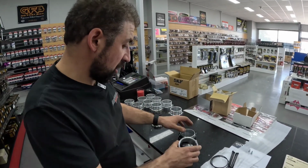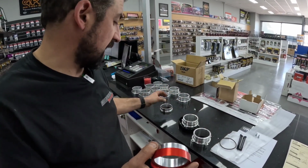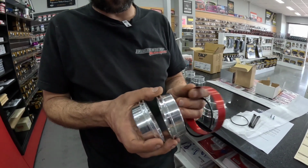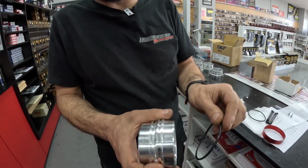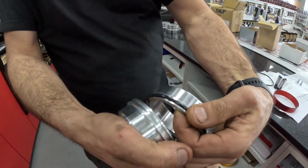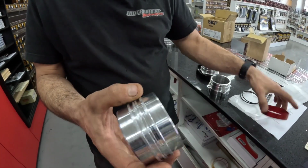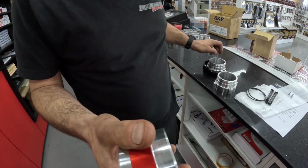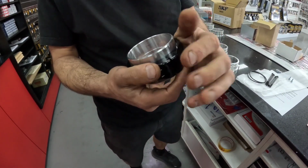But how it sort of works is we use the Plazmaclamp clamps, and I'll give you a quick rundown for those who don't know what they are. So these two aluminium bosses here have a groove in there for an O-ring. So once these two O-rings go on there, that's how it looks there. And you can picture both O-rings there. What it does is, when you have the two O-rings there and these are welded to your intercooler pipes, when you slide this shell over it, the O-ring seals on the external of it, and then the Plazmaclamp basically drops over the top of it and locks it all together.